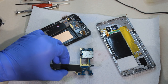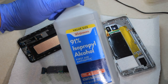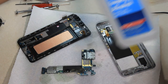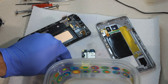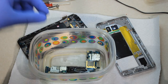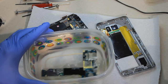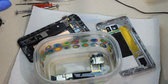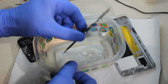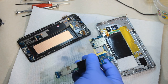What they recommended — and what we're going to do — is get out the rubbing alcohol, 91% or higher. A lot of it out there was 50 and 70%, so we went and got the 91%. We dropped the motherboard into this dish, swished it around, and put a lid on it because this stuff does evaporate. We swished it around for probably 10–15 minutes, then took a soft toothbrush and started cleaning up the connectors.